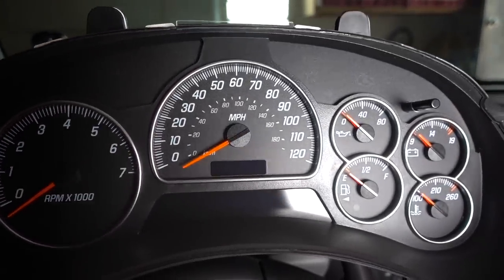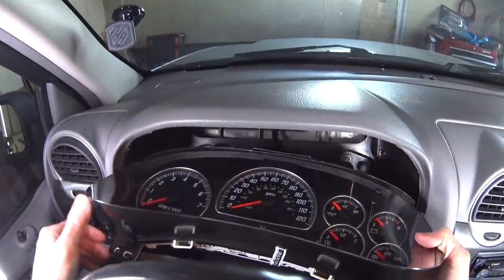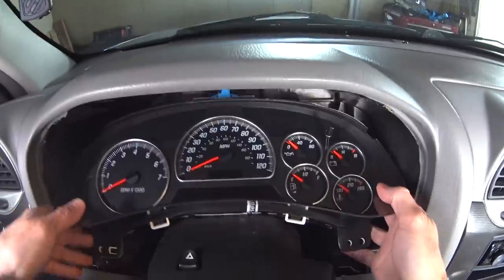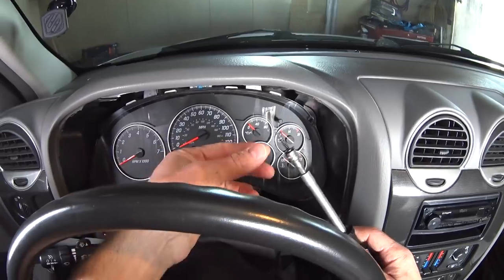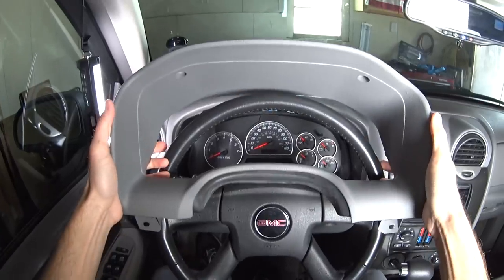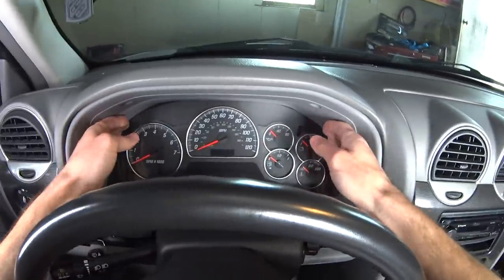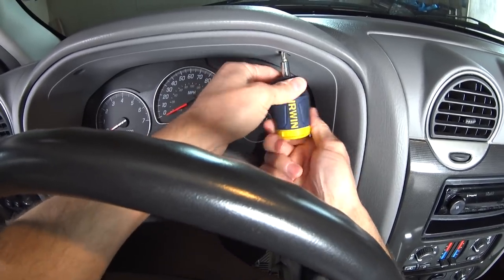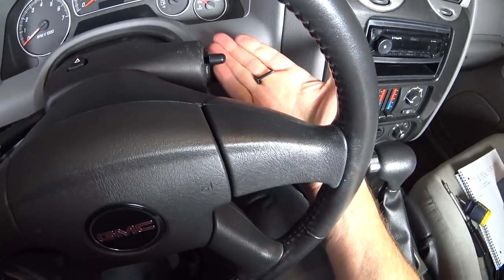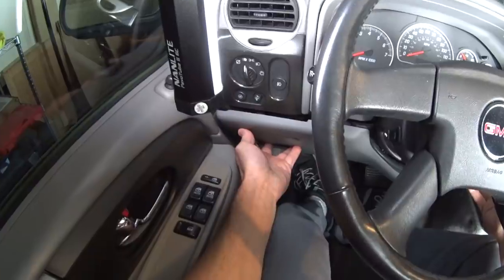Taking a look at this cluster just out of the plastic it looks fantastic, and you can see on the bottom here he's marked the date indicating he's done a full rebuild. To get this reinstalled I'm first going to slide the cluster in and reconnect this electrical plug. Now I'm going to put this back into position — the cluster is now fully seated, I just need to secure it back with the four screws. I now have the cluster plugged in with the four screws securing it. The last thing I need to do is reinstall this trim piece — it should fit in there pretty evenly. If you have to force it you're probably doing something wrong. On the bottom of this bezel we do have two screw holes — one on this side and one on the other.